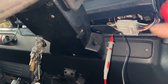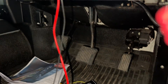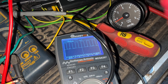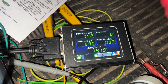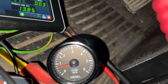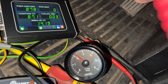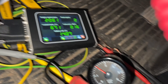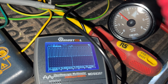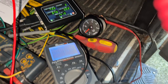We've got a bit of a lash-up going on here, but pin 14 of the cable going to the binnacle is being fed down to the tacho — excuse the engine noise, it's obviously running. I've got a little oscilloscope set into the same cable and my black box Nanocom reading — you can see the revs: 744. The £20 rev counter is working. Let me just increase the revs — up to about 2000 — the frequency on the scope increases and decreases with revs. So yeah, all hooked up and working.